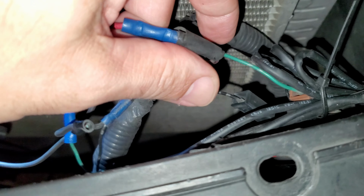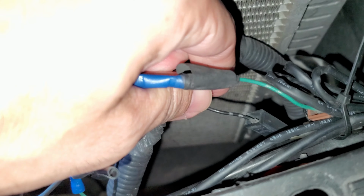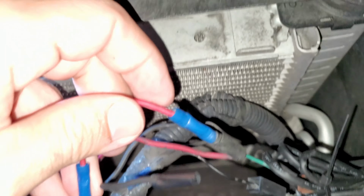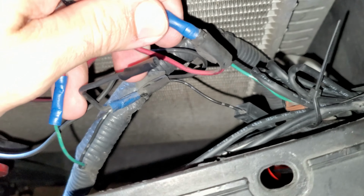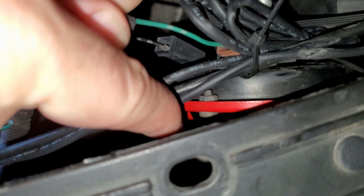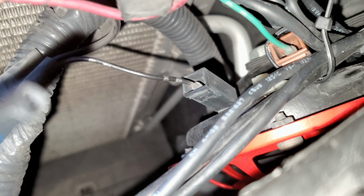that it sounds. So what I did was I took the horn connection here, the green wire, make that positive, and this black one, make that negative, okay? And I spliced it, I cut the wire and ran two cables, okay? One to, say, call this the low, and one to the high, using the same connectors that came in the factory horn, okay? See this brown one here and this black one there, all right?